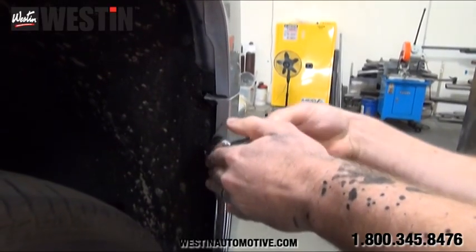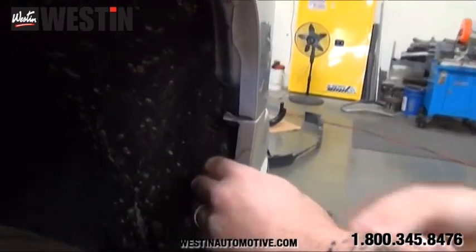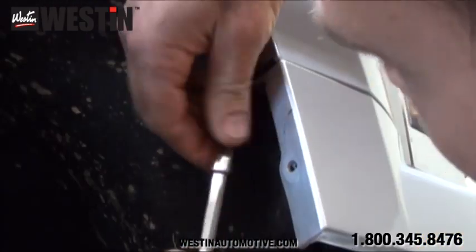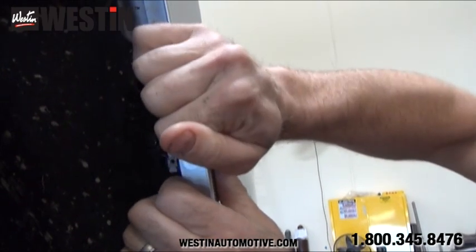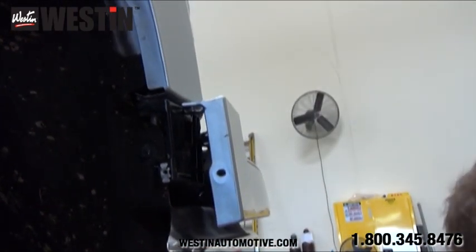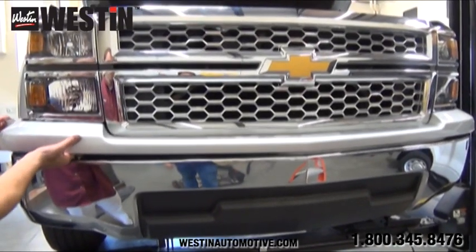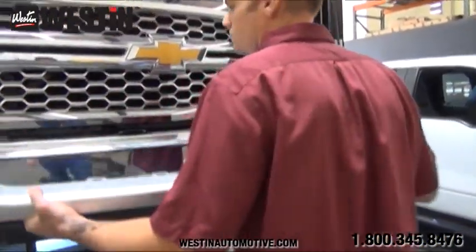Next, the filler panel from the front of the vehicle is going to have to be removed. We can start by removing this factory fastener, and then there is also another factory fastener located up at the top — where an arrow is pointing — that must be removed as well. Now that the fasteners are removed, we can begin removal of the filler panel by pulling gently on it from the side. To fully release the filler panel, you must come underneath the vehicle and pop loose all of these plastic tabs that are retaining the filler panel to the grill. Once all that has been done, we can simply pull on the filler panel, remove it, and place it aside to be reinstalled later.